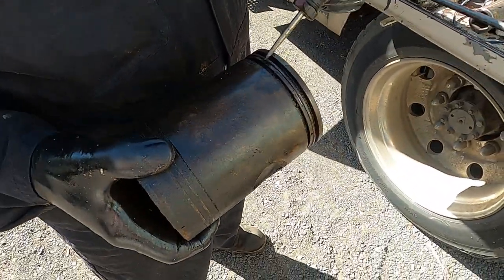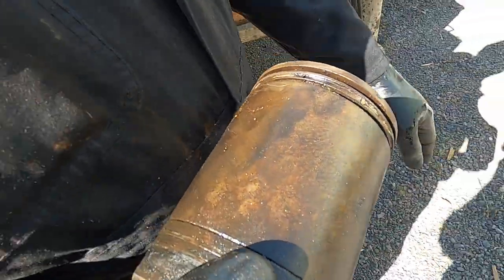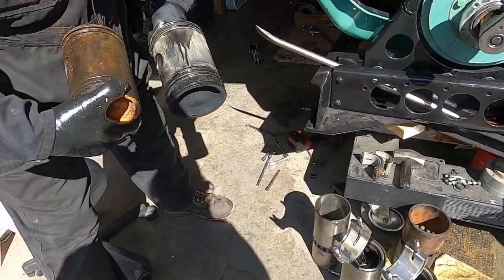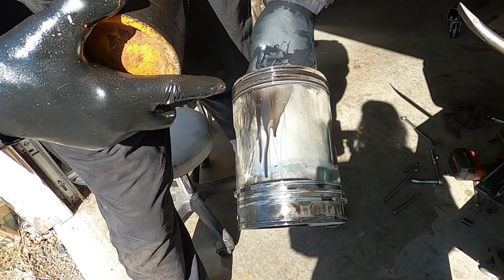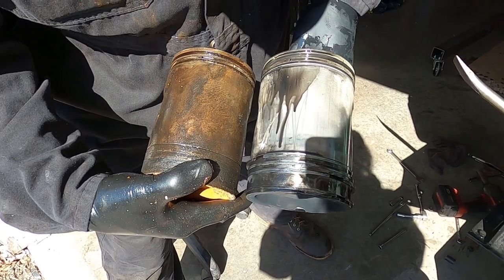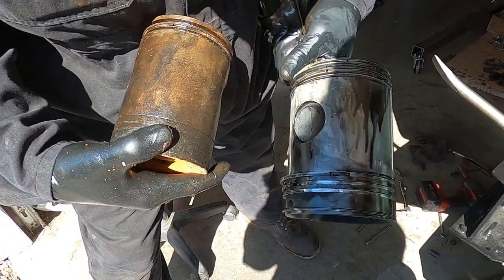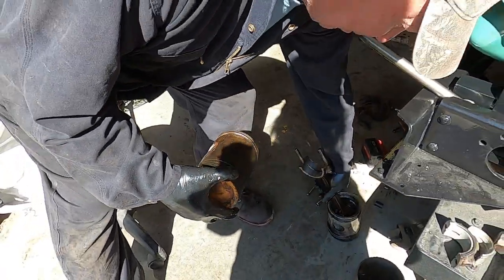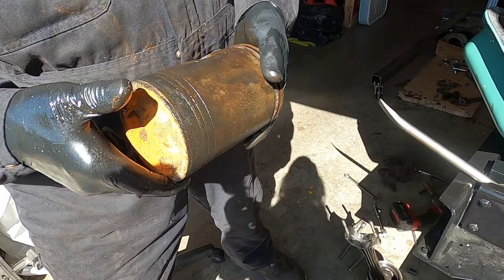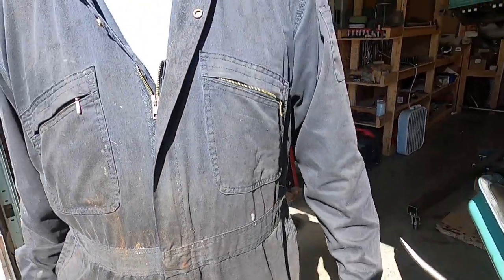They changed the way the oil holes go, and the bottom of the piston changes — that's about oil consumption and too much crankcase pressure. They call it a J-relief — they move the holes on the bottom to keep it from having too much crankcase pressure. By the time the 92's got online, it took them a few years to figure this out. This setup here doesn't cause any problems — you don't have blow-by issues, you don't have oil consumption issues.